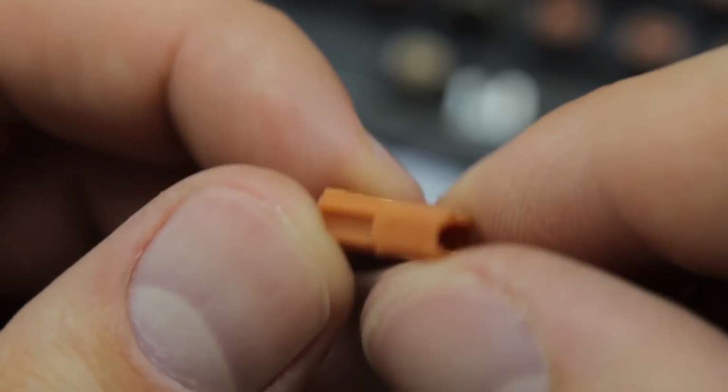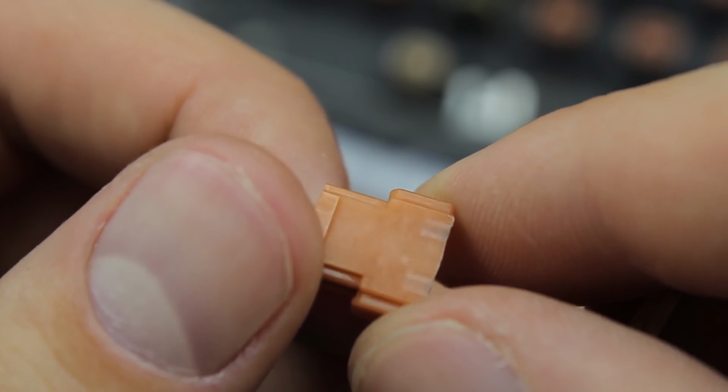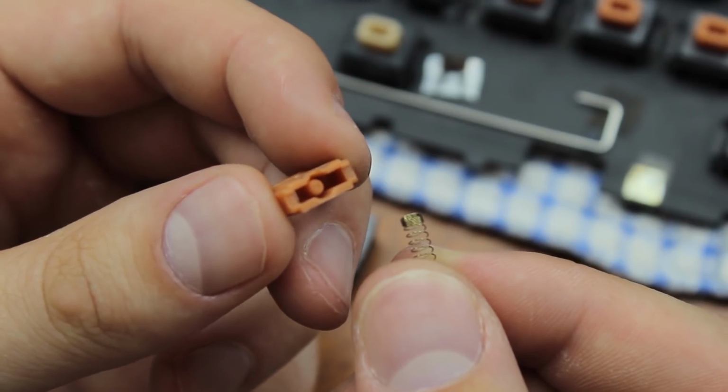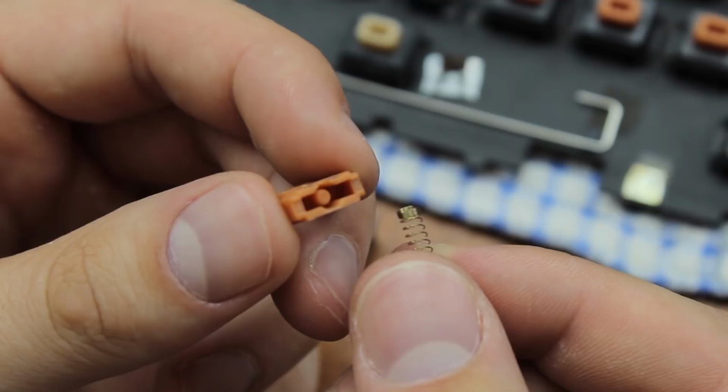And something similar goes for the tactile leaf. The tactile leaf is least often at fault in my experience though. Finally, there's friction between your spring stem and the spring itself. This is not usually a huge cause, but it can get pretty bad if you have very rusted springs, in which case you might want to consider swapping the springs as well.